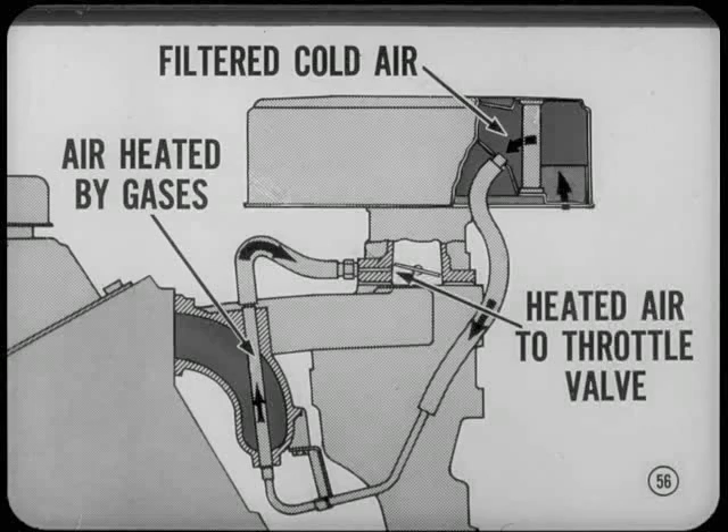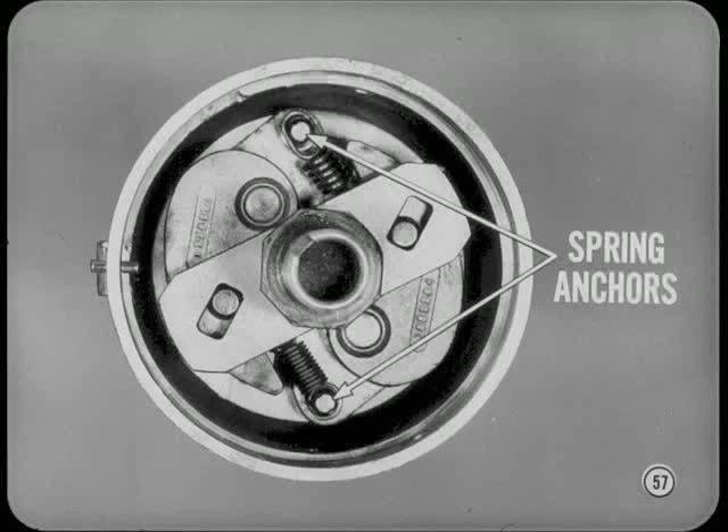Both of our sixes have a new anti-icing feature. Filtered air passes through a manifold tube where it is heated by exhaust gas. The heated air is then admitted below the throttle valve to reduce icing. On ignition, the distributor used on V8s no longer has adjustable anchors for the centrifugal governor springs. If the advance mechanism is out of calibration, the complete shaft assembly must be replaced. And most '69 distributors have new cams, so be sure to check the dwell specs.